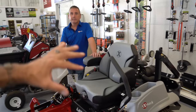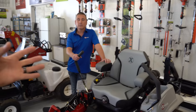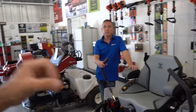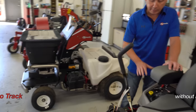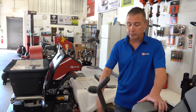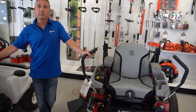So you've got two tires, your machine's not tracking right. You measure the circumference of the tires, and whichever one is bigger, you've got to take the smaller tire, blow it beyond its rated PSI, leave it set in the sun to expand it out, then put it back down and put it back on. Tires are no different than a bag of balloons — you pull them out and they're not the same size. You can blow it up and stretch it out. You guys can probably get a machine to track straight going forward, but the problem is when you put it into neutral, that tire is going to be trying to roll backwards. When you set the parking brake, you're going to start burning up the hydro. All the guy was trying to do is get his machine to drive straight and he burned up his hydro.